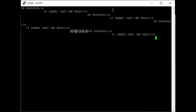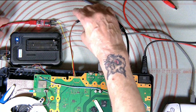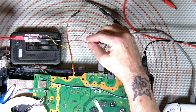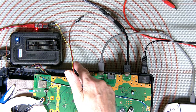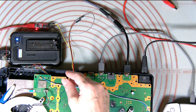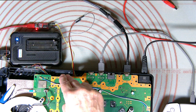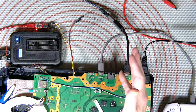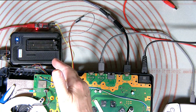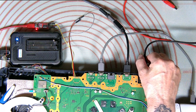So the machine's off. We have a UART connected at the back — this particular one is wired in on that part of the board. On the other side you may have noticed there are pads for a plug; in fact one or two of those pins are the RX and TX to the Southbridge serial, which is a bit of a pain because it's underneath. I'm using it for a work unit and I've got the NOR wired up as well.